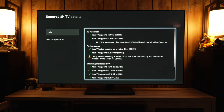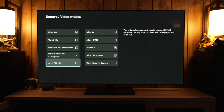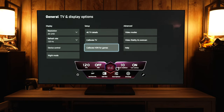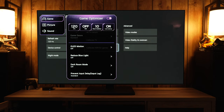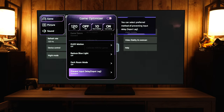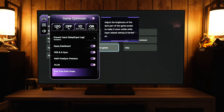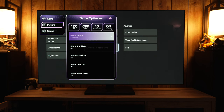Now switching to gaming. Starting with the Xbox at 4K 120Hz — you can see all the green check marks except I have Dolby Vision off for gaming. Without a calibration, the Dolby Vision game mode is very inaccurate, so I don't recommend using it unless you have it professionally calibrated. You'll notice the Game Genre setting in the middle is sometimes grayed out — this appears to be a firmware bug right now. For input delay, leaving it at Standard is preferred. Setting to Boost at 60Hz improves input lag by a few milliseconds, but it can affect gamma, so I leave it on Standard.